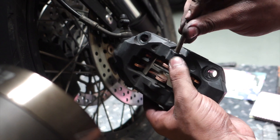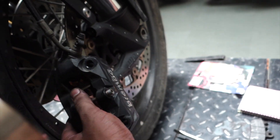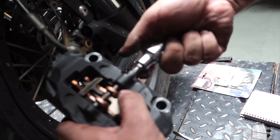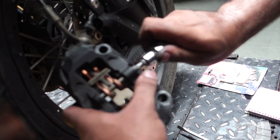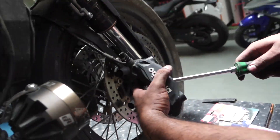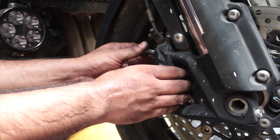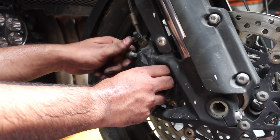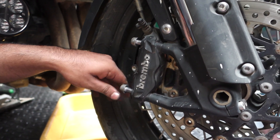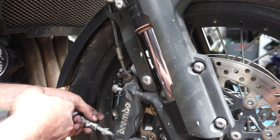This is how the clip sits. And now he will tighten the bolt. He is using a screwdriver to separate the pads and he put it back. Done. It's the simplest of processes. Anybody can change a brake pad at home. Depending on your motorcycle, you will have to figure out what size of bolt to use, but this is the basic process — just tighten it down.